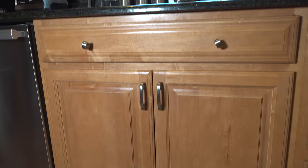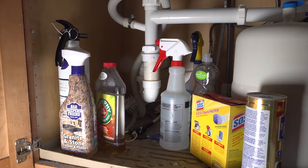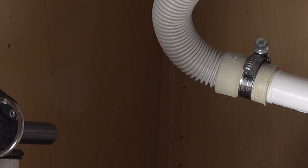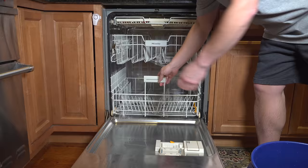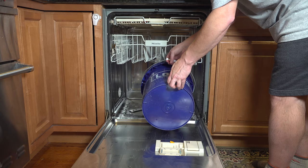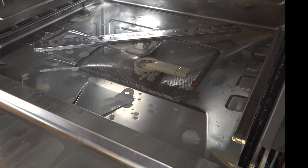But what if you do all these things and you're still having problems? Maybe it's your machine itself. I'm going to give you a simple test you can do to check the performance and make sure your machine is actually working. You're going to start by going underneath your sink, and we're looking for the drain hose from the dishwasher. In the US, almost every dishwasher connects into the drain the same way using a hose like this. Go ahead and get yourself a five-gallon bucket or a similar container to hold some water. Fill the bucket up with about two gallons of hot water, then open your dishwasher door — you want it to be empty — and remove the lower basket. Take that bucket of water and start pouring it into the bottom of the dishwasher, filling it up as much as you can without overflowing, at least enough to cover that filter screen.